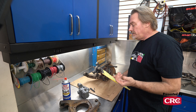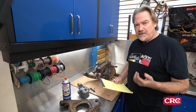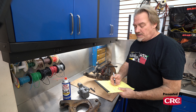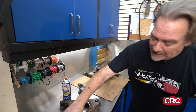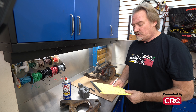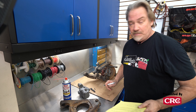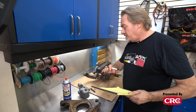As you're going through these parts and taking stuff apart, you should be doing two things: have your iPhone out and take pictures of every part, and have a notepad. Right now is the time to say, I need new control arm bushings. In this case, we're going to use an offset control arm bushing — a hooligan hot rod thing to get more negative camber in this car. But you should make notes as you go.